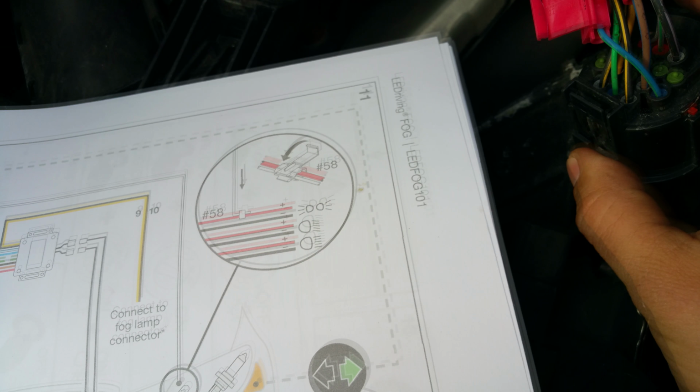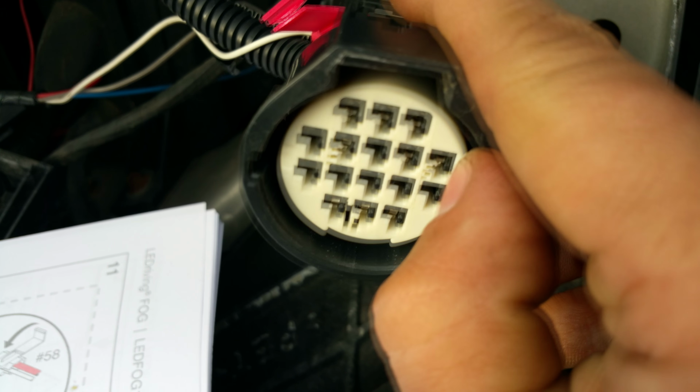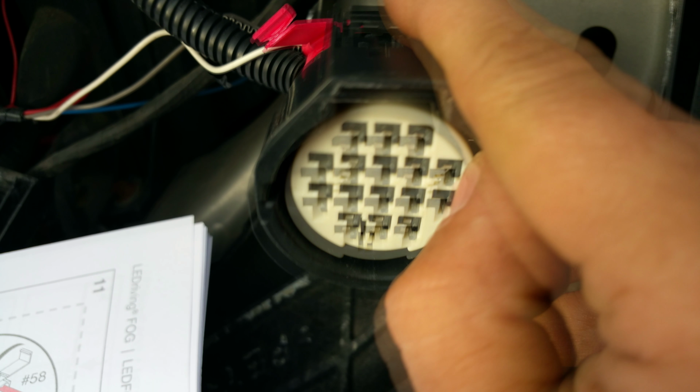And we've got another one which is the grey wire, which I can't remember what it's for, but the grey wire, if we follow that to this Scotch block, it is bright blue with a green stripe, and that one is going to the second column and on the right hand side, so they're right next to each other. So if you're counting from top left, it'll be 1, 2, 3, 4, 5, 6, 7 and 8 in that. And just Scotch block them together.